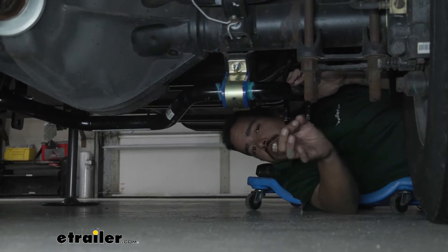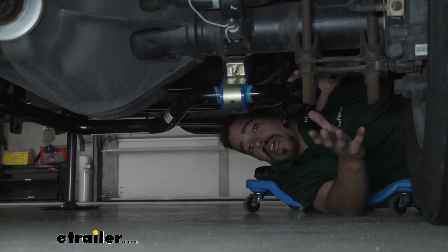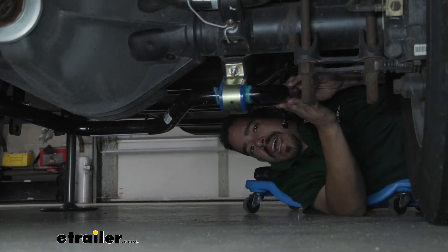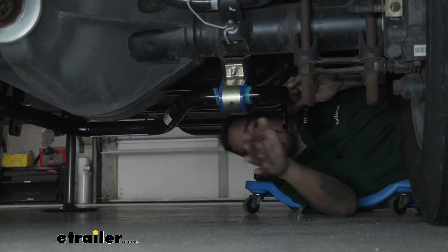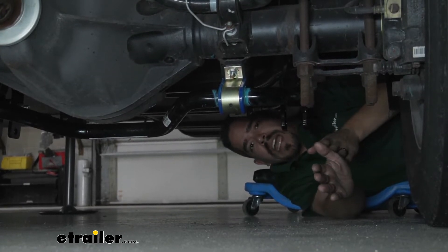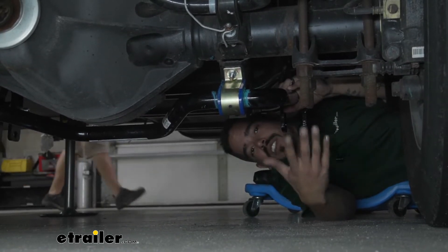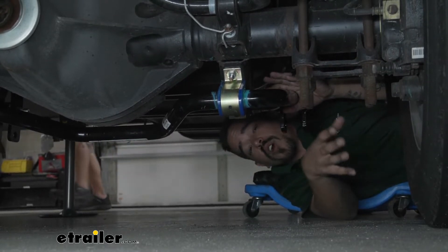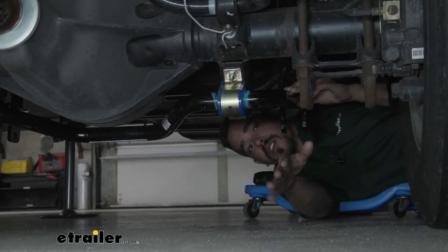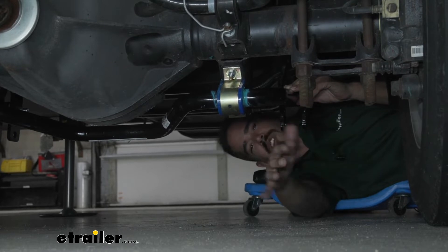The bar itself is going to be an inch and a half in diameter. When you add that to the existing sway bar that's already there, we're going to get a lot of support back here and really minimize the amount of sway we're getting. A lot of times, especially in the back, we end up getting a decent amount of sway, and it feels like it's pushing us around — especially if you flat tow a vehicle because that's a lot of weight in the back. Once that starts pushing the back around, it starts to push the front around and we end up having to fight the steering wheel, and we're exhausted by the time we get where we're going. This is definitely going to cut down on all of those things because it's going to make sure that our rear axle stays nice and level, and as we go in and out of the turns, it's going to use the weight of the axle to brace itself and prevent that weight shifting and that really mushy feeling that we get.